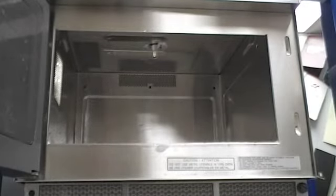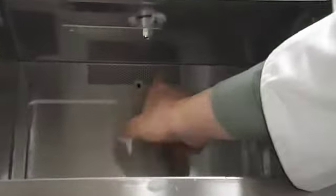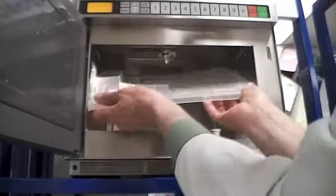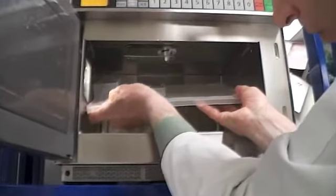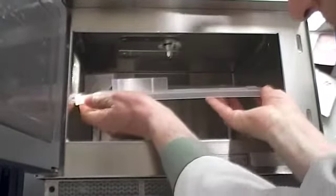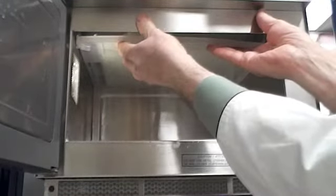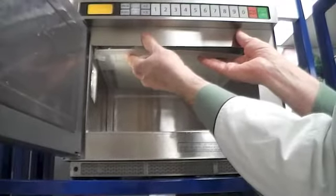What you'll see in the back are three holes. When replacing the splatter shield, make sure those three holes align with the three tabs on the splatter shield. Simply reinsert the clean, washed, and sanitized splatter shield back in the oven, and press it up into the ceiling. You'll feel the tabs click into place.